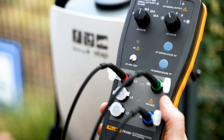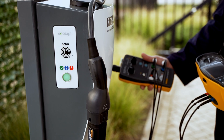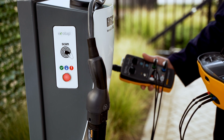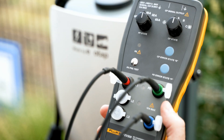Rotate the dial to status A, then B — all ready to charge. Finally, select status D. As most charging stations do not provide charging with ventilation, the charging station should show an error condition and the charging output should not be activated.